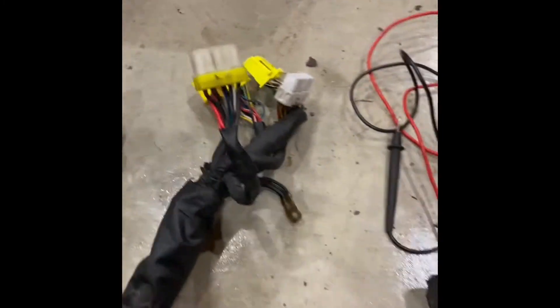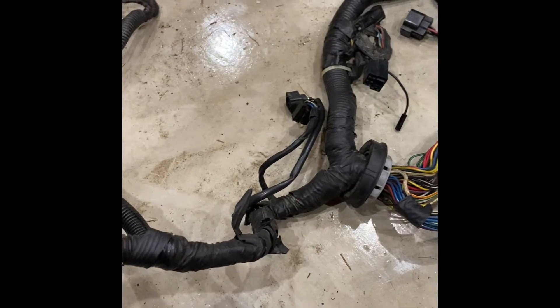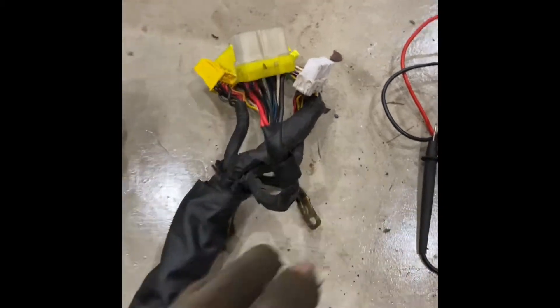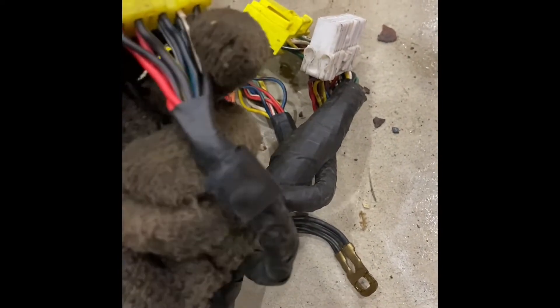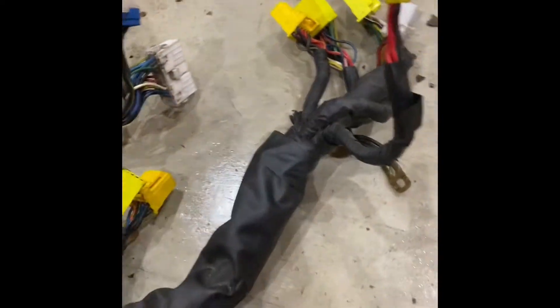The black with green is the fuel pump wire. I don't actually recall exactly where that connector is — it's somewhere in the harness — but if you were to snip it off right here, or take all the tape off the harness, you can just pull it out and run it directly to the fuel pump.